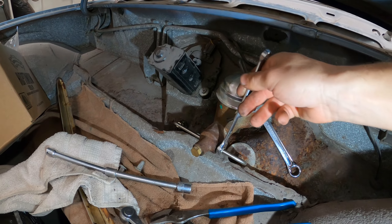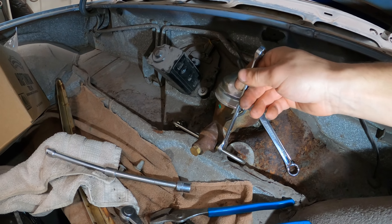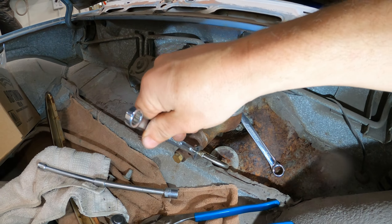Stainless lines are pretty silly. They are much harder and more difficult to bend than normal mild steel lines, and they are way harder to bend than nickel copper lines. If you use a channel lock to line up the end and get it started a turn or two, you're going to be a lot better off than just struggling. Just take it easy — get a light grip on a vise grip or channel lock and get that thing started with one hand. You'll be a lot happier in the long run.